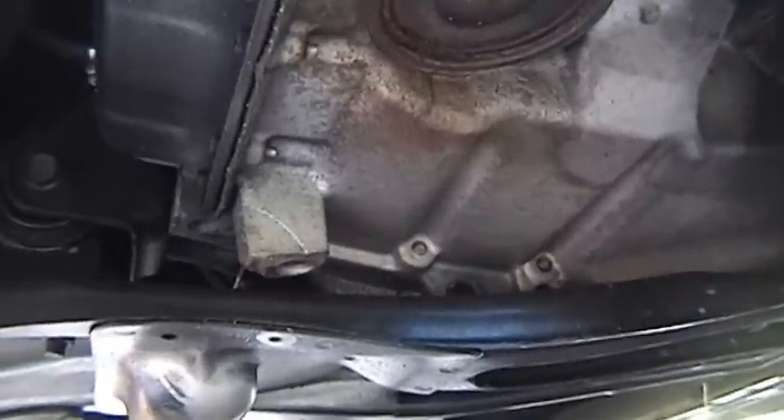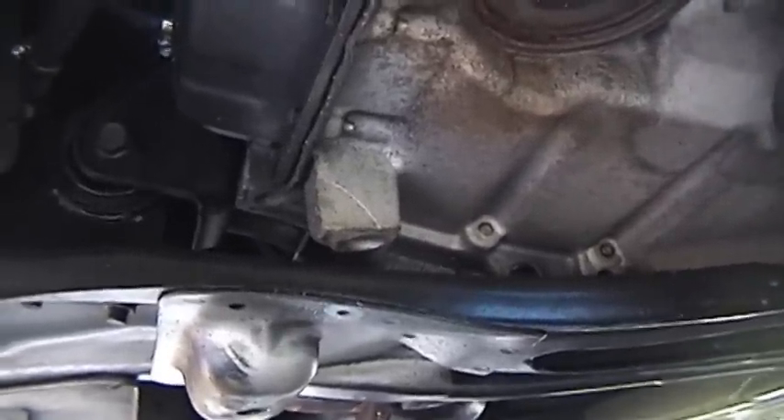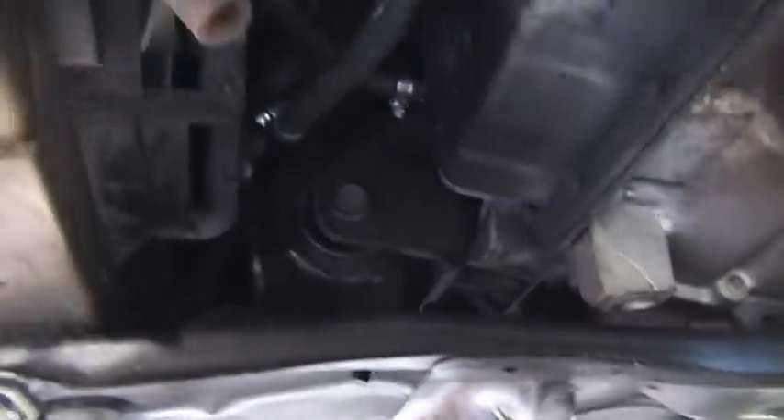The purpose of this video is a complete head teardown. Why am I under the car if I'm tearing off the head? Well, for this model of 626, you can't get the heat shield off the engine because the distributor is in the way, so you have to take off the pre-cat, which would be attached to this down pipe up in there. Then you have to take off the down pipe and flex — included with that — all the way up to the catalytic converter. Loosen that up, then go up top to the cat, remove the bolts from the pre-cat, and the down pipe should drop right off.